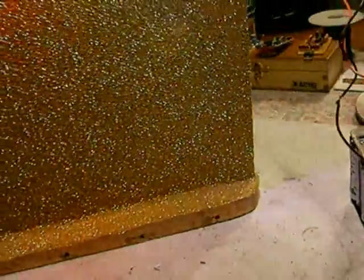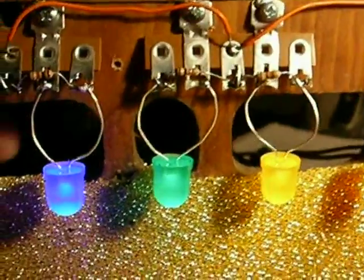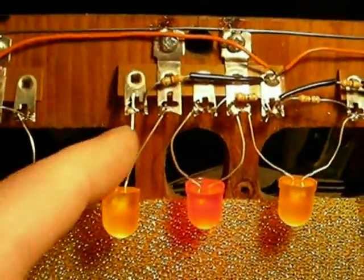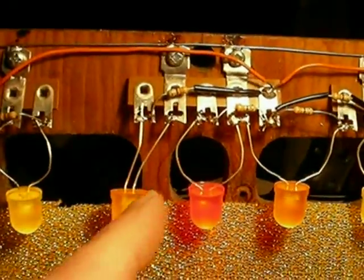After you get the thing in, you have to put the metal grill mesh on first, then you have to put the selector face right there back in. Then after that's in, you can put the button panel back in. Also notice that the way these LEDs are put in here — they're bowlegged — and that's because the buttons have to go through the front panel in between the LED legs and come out the front. There's not a lot of room. A couple of these are kept close together and just bent so that they're even across the front. Every one is bowlegged so that the buttons will fit through.